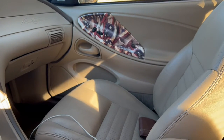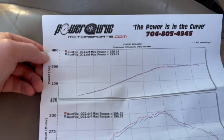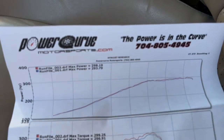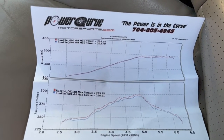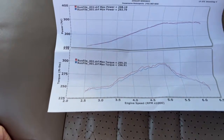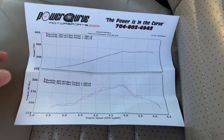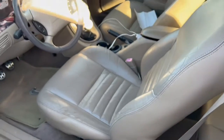The people I've talked to say it isn't too bad for this car — about right for a full bolt-on car with long tube headers, full exhaust, GT cold air intake, and a 60mm Accufab throttle body. Still stock gearing in the back so it's a little slow. Right here we've got 298 horsepower. The guy at PowerCurve said if he tunes it on the dyno he could probably get it up to 300-something — maybe 310. Torque is at 299, so I want to get both of these up. I want 300 horsepower — I know that's not a high goal for nowadays, but it'll be good for this car.